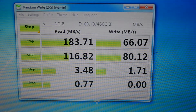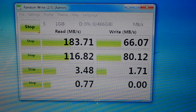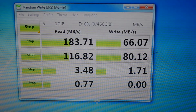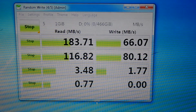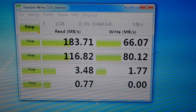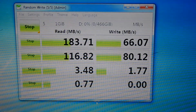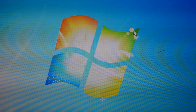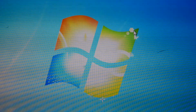Also, they're a bit loud in the NAS case, especially when there are a bunch of them in there, even though there are only two. The second one I got has 7.5 years of flying hours, only 2 reallocated sectors, which is fine, and only 40 starts and stops, so it probably saw 24/7 server use. Okay, but those two Seagate drives, the little Constellations, have seriously surprised me. That's it for this video.